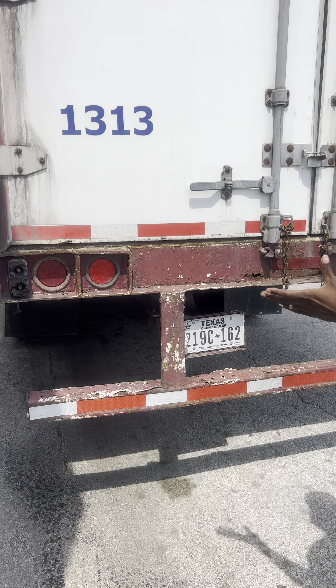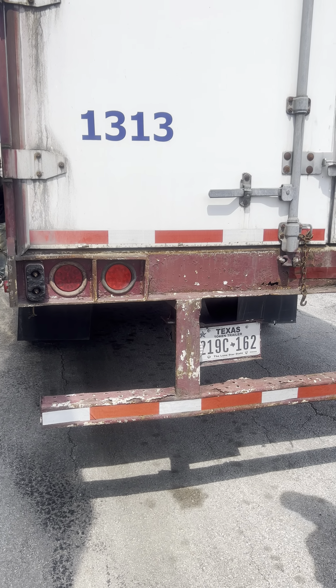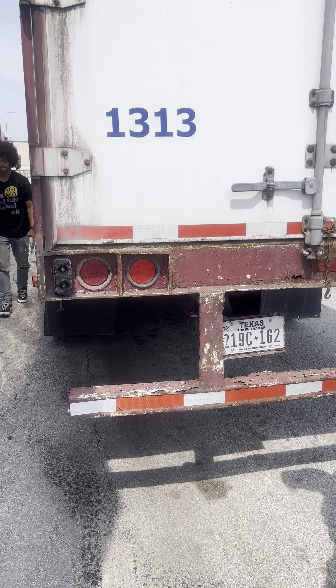I have my tail lights — they are red in color, properly mounted and secured. My outside lights have two functions: my turn signals and four-way flashers. My inside lights are my brake lights. Up top, I have my three marker lights, red in color. I would check this side the same way I checked that side.